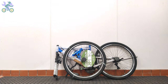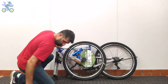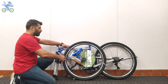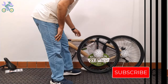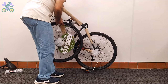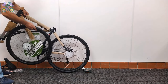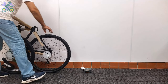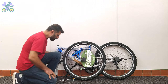For ease of assembly, remove all paper and plastic covers from the bike. However, be careful not to damage the paint on the body when removing them, as this may lead to rust over time. Also be sure to remove any remaining tape from the body as it will affect the bike paint over time. Sometimes, especially for bikes 24 inch and up, removing a bike tire can be challenging. Be careful not to apply too much pressure when trying to remove the tire because it can lead to bent or broken spokes. To successfully remove the wheel, gently push the bike forward and backward while rotating the tire in the same direction to release it.